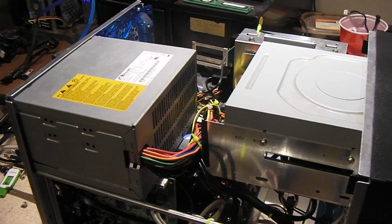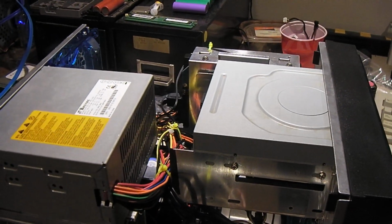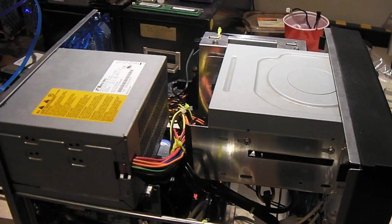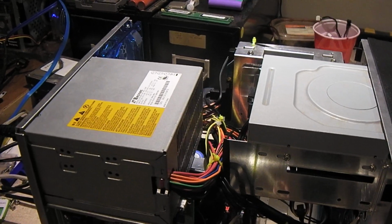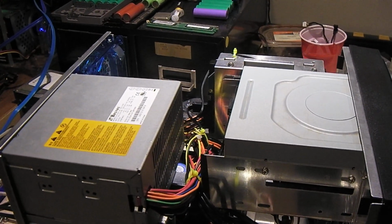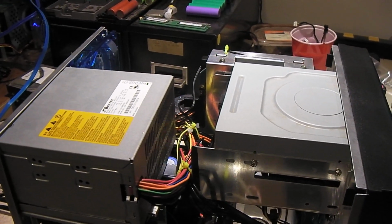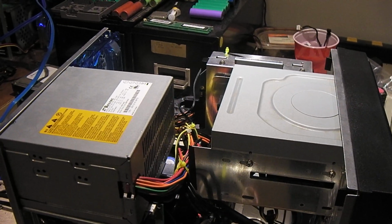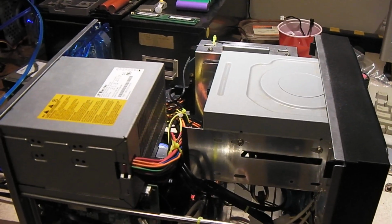but then I came to realize that the motherboard in this machine, the ASRock A520M-HTV, well, the A520 chipset does not support overclocking. Now, there are overclocking options in the BIOS, but they're kind of limited. And AMD's Ryzen Master basically told me that the system did not support overclocking, so I did some looking online and discovered that the A series chipsets, like the A520, did not support it, but the B series, like the B550, do support it. So to my understanding, it's the chipsets, not the processors, that don't support it, but the B series and the X series do.